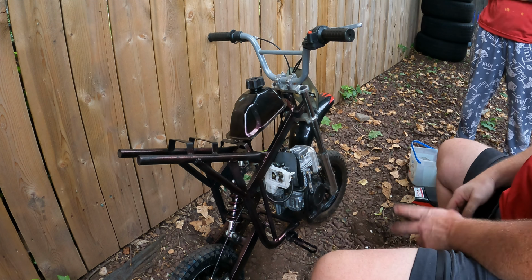We also have a problem with the choke. The choke just keeps flexing. All right, guys, one of the biggest issues I had with this was this thing would just open and close at will. What would usually happen is it would just go like this, and that's choking the motor. Whatever mechanism was in this is broken, or wasn't here, I don't know. It just moves too freely.